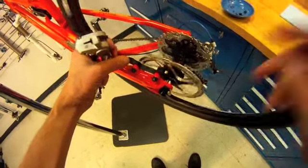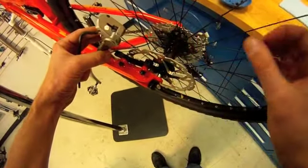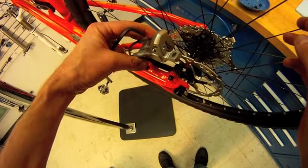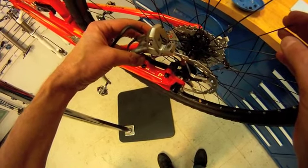The bleeding is not our concern here. The rotor is fixed — this rotor position is locked, it's not going to move around on us. We can adjust our caliper body side to side to some degree, but we want to get the best position centered over it.